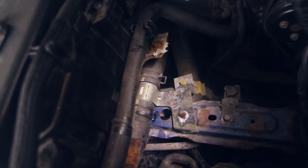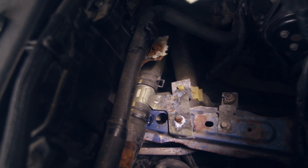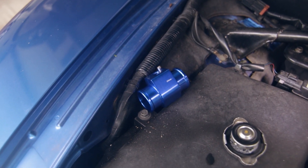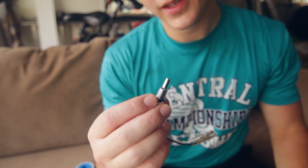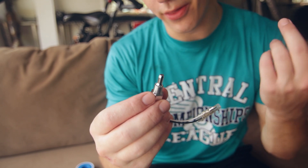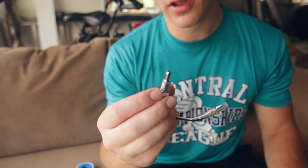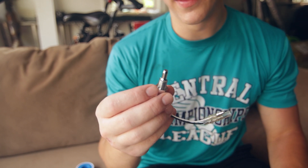The piece connecting those two hoses — I just sprayed it with some WD-40 and loosened it up. That piece is what we're going to take out and simply replace with the water temperature adapter. But before we replace it, we've got to put Teflon tape on the water temperature sensor and screw it in. This is the temperature sensor that comes with the ProSport gauges — it is essentially a thermistor, a temperature-varying resistor whose resistance changes with temperature, and the voltage output is calibrated and converted into a temperature reading.